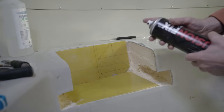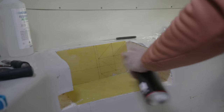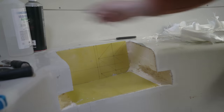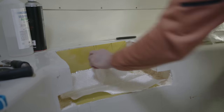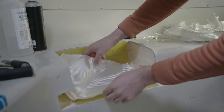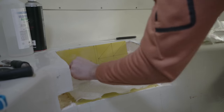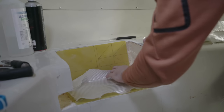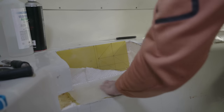Let's zoom bowward to where the last episode left off. In our new recess for the diesel heater, I've placed the sheets of fibreglass in to give me a flat base, and then the first task is to glass them in — both to stop any damage to the foam, and also so that there's a watertight seal. I've decided to use woven fibreglass fabric here. It's a twill weave that can handle corners and angles, and is around 200 GSM — so that's 7 ounces, to those who prefer things not to be divisible by 10.